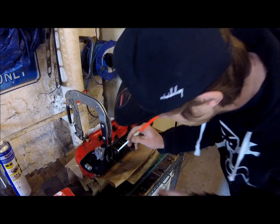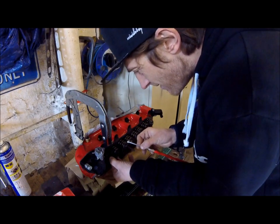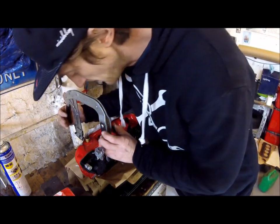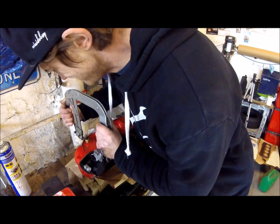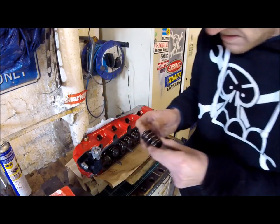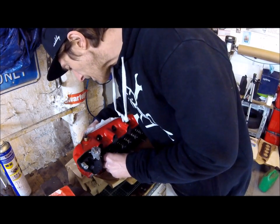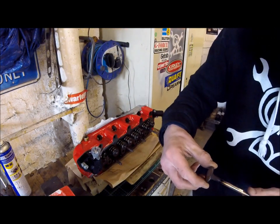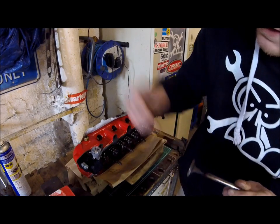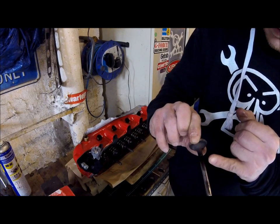Now here's a magnet - I'm going to pull the collet off. Yes! Look at that. So release this slowly and hopefully that won't go shooting away. Oh, slowly. Double valve springs and the top hat. And the valve itself - it's got some dirt in it that I was cleaning the other day. In lapping this valve back in, it should give it a nice seat to the head again. I know that I've got to be careful with this bit here, but I don't know about this top bit - I suppose I could give that a wipe off.